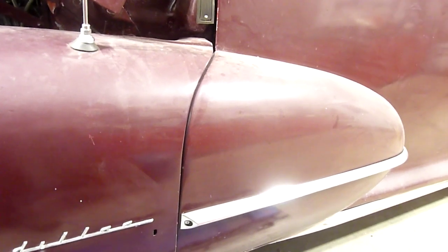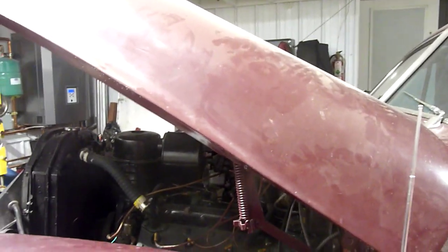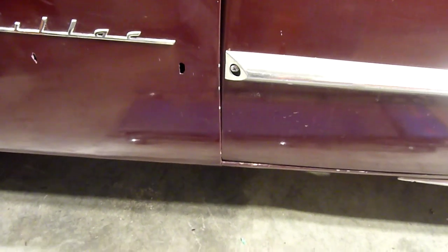Some of the methodology is coming clear. What I should have done when I had the whole front end off of the car was set the hood to alignment for distance and length first — clearance to the cowl — because now I have too tight a clearance between the fender and this wing right here.